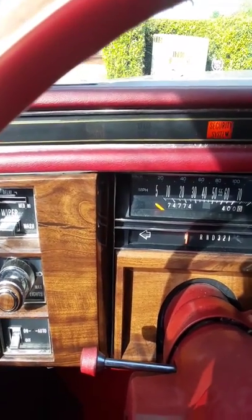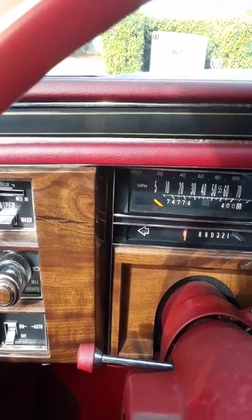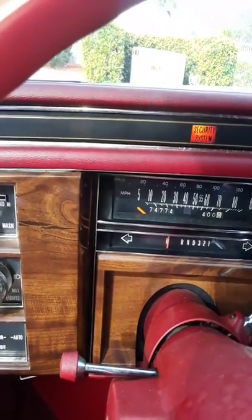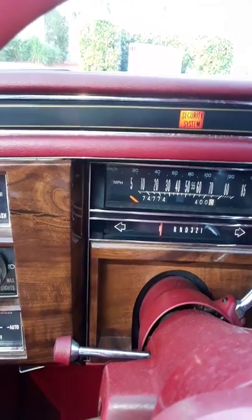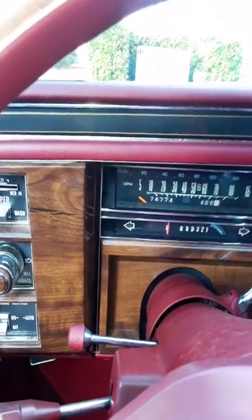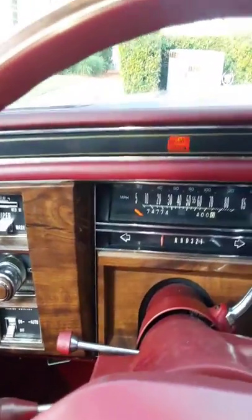Code 12 is shown by one long flash and two short flashes, and that code will show three times. If you have a check engine light on, after the three repetitions of code 12 it will send you the actual trouble code. You can look those up online — there are hundreds of lists to check what the problem is. Most likely it's just a bad sensor or something similar.